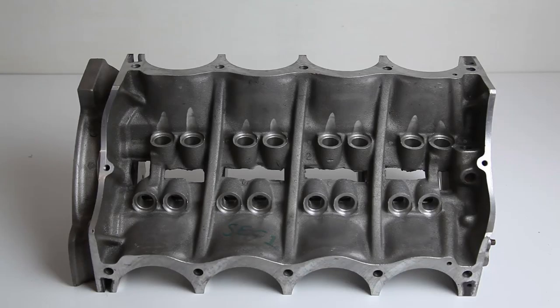I've just asked Steve to splice this picture in here, because what I forgot to show you before I rotated the block round was the machining marks, which you can now see with the red arrows on them. As you'll notice at the lower side of the picture where the blue arrows are, there are no machining marks. This goes to show that the block was cast off-centre, or offset. The machining marks are from the milling tool that comes down and takes the material out for the tappet hole. If the block was cast perfectly there wouldn't be any, and if it was cast oversized or undersized it would be on both sides — so it's not central, which adds to all of the issues we're showing you here.